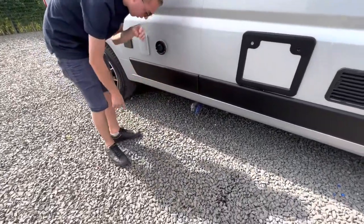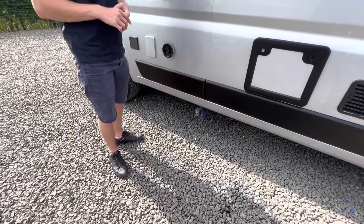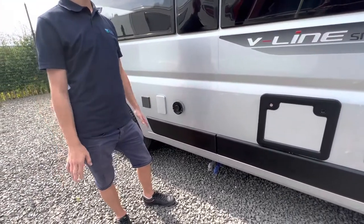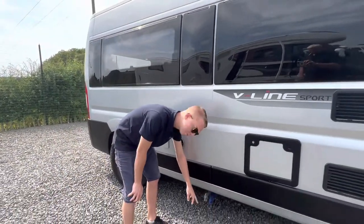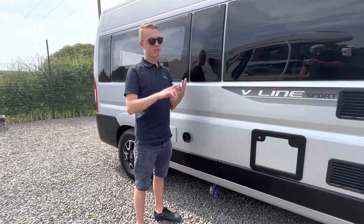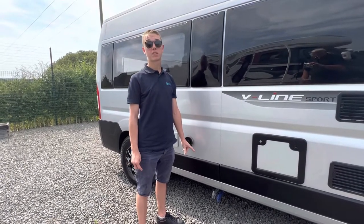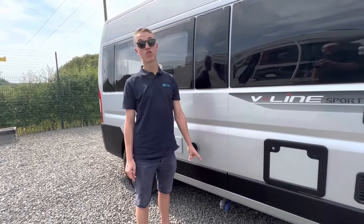Next you have a blue and a grey tap. Blue is fresh water drain — so if you've taken on contaminated water, you're not using the van for the winter, you want to winterise it, or you're just not using it for a couple of weeks, let the water out via the blue one. The grey one is all your dirty water: hand basin, shower and dishes water. Ensure that's drained off before you leave your site so you're not driving with excess weight, which impacts your payload and fuel consumption. Also make sure it's fully drained in the winter.